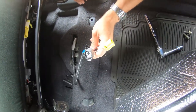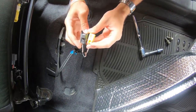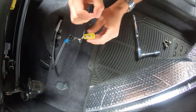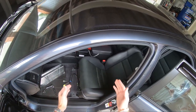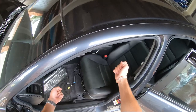On the gray one it's the same on both driver and passenger side — just push the button in and it comes out fairly easily, a bit more standard. This one here is a little bit tricky — you've got to pull the clip, pull the slider back, and then just pull it off. Also take the headrest off and put the seat fully leaning forward as it makes it a much smaller profile, so when you bring it forward you can bring it out.